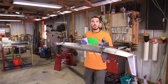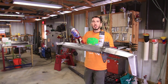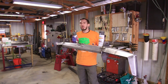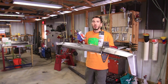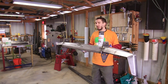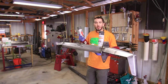The next step is to prime it. You can use regular automobile primer if you'd like, but I'm going to use self-etching primer. The self-etching primer is a little bit nastier, so you want to use a good respirator. We're going to do this in three steps. The important part is to put this on in light coats — be really patient. We're going to stand back, spray a really light first coat, then a light second coat, then a third coat. I'm going to put my respirator on and do that now.